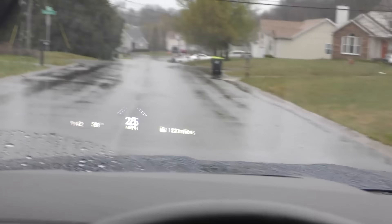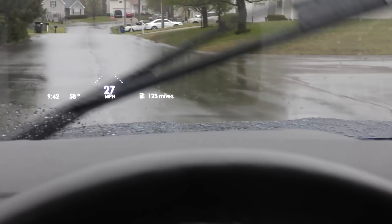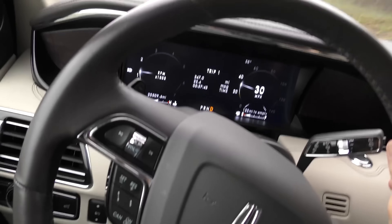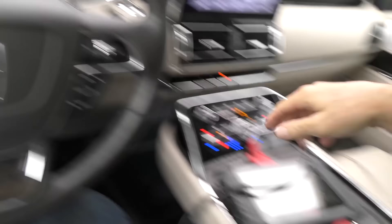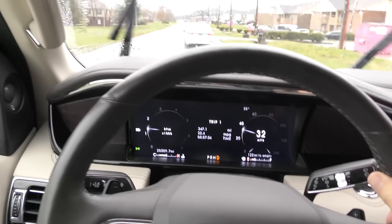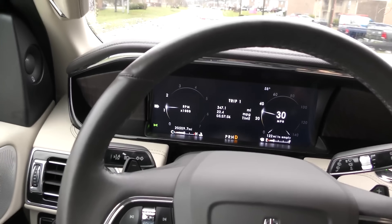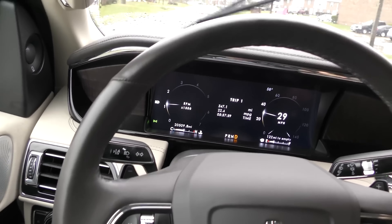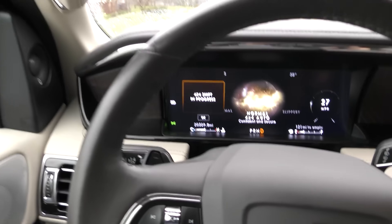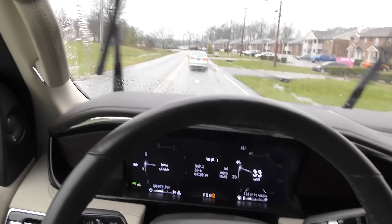High-riding vehicles got a good ride — big heavy vehicles take bumps better. We're driving a little slow because there's a turtle in front of us. At this speed when I cruise a little, I can feel some hunting for gear in the 10-speed transmission. It is a 2020 — I've been in the newer ones and they are a bit better. Now if I switch it into a different mode, we'll see what happens. Switching to four-by-four — now the hunting is gone. Often when you shift modes, the hunting will go away.